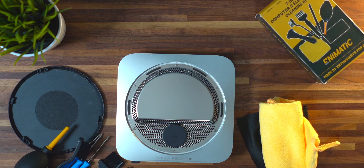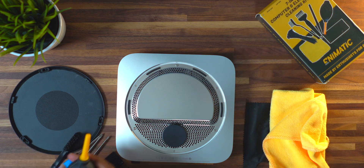We got all the necessary things we're going to need to clean our M1 Mac Mini. The first thing you need to do is take something like a regular credit card or an Amazon gift card, and just pry around the outsides like so until you start hearing little clicks. It's not going to hurt it — all you're doing is loosening the back plate from the back of the unit. Once you go all the way around, you're done with the card. Take the plate off and, as you can see, there's a little bit of dust in here.